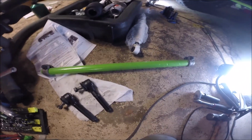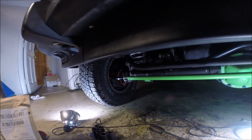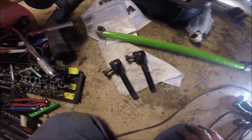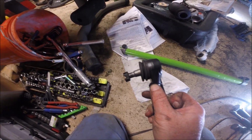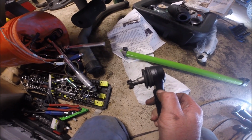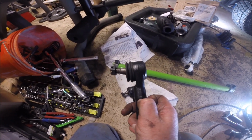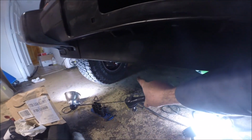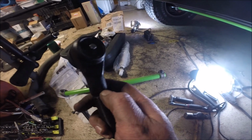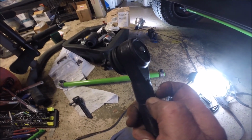All right, so about to assemble the drag link, and one thing I want to point out is that with the kit, you get that tie rod end over there, which has an elbow in it and a hole for the bottom part of the drag link to attach to, and it comes with two tie rod ends that are kind of short. See where my thumb is right there? That's where the threads begin, and there's not much room between the actual ball joint area and the threads. Only one comes like this, and on this one it's longer. There's a further distance to the threads. That one, according to the instructions, attaches there to the elbow in the tie rod end. So the bottom of the drag link should have this longer extension on the tie rod end itself. If anybody knows different, please leave a comment and let me know. But I think that's what it looks like in the directions.